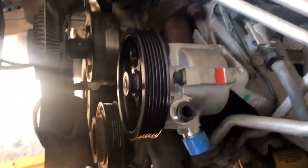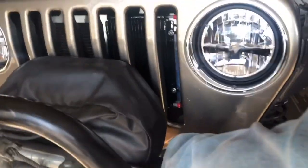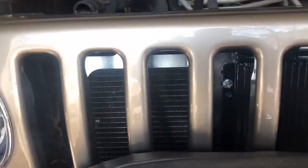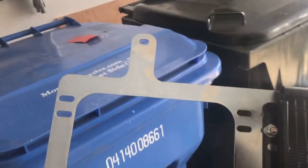The new PSC power steering pump is mounted. We're doing a little bit of lining up to figure out how best to run the hoses. We're going to relocate the cooler to the passenger side of the Jeep — right now you can see it in the grille on the driver's side. We'll move it over to the left so there's a more natural flow of hoses in and out. The cooler comes with this bracketry and gives you a couple of options for where to locate it.